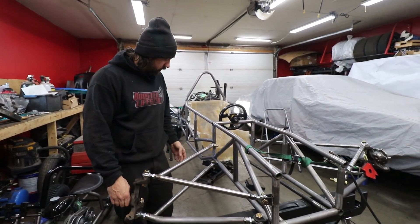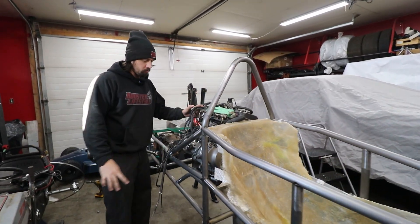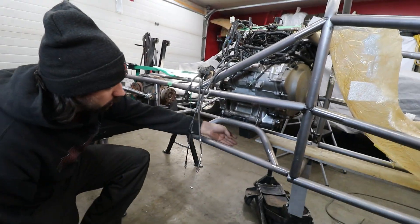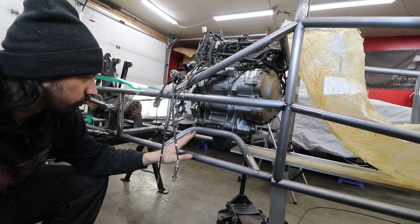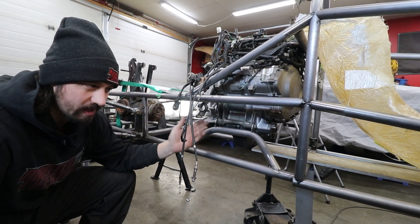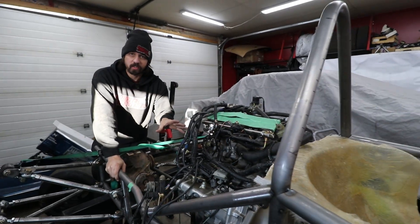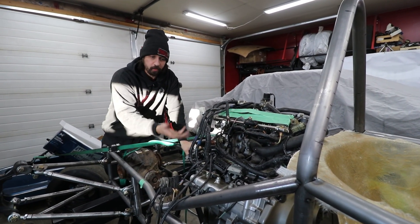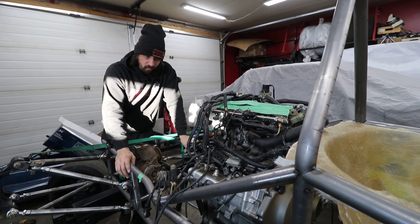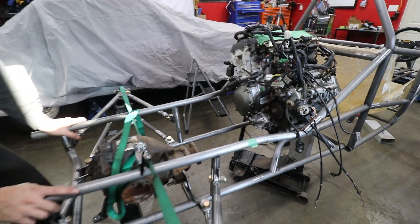We finished our front end travel - it's not gigantic but it's sitting higher than the ride height is supposed to be. We're going to move back here and I'm thinking I'm probably going to drop the engine a little bit. The reason I didn't drop it is the oil pan sticks down quite low. Right now the oil pan is level with the top of this bar - I can probably move it down to the bottom of this bar and still be okay. So we'll drop it down probably like an inch, an inch and a half. The driveline angle is going to be more important than having the engine sit super high. I'd try to move the engine up to service the oil pan if I ever need to pull it off, but a more direct driveline angle is going to be more important than the clearance on the oil pan.